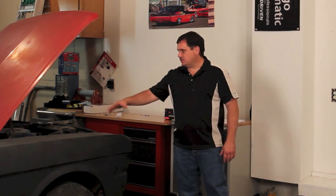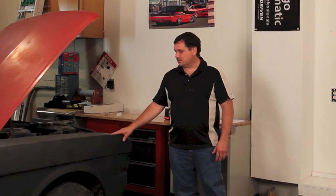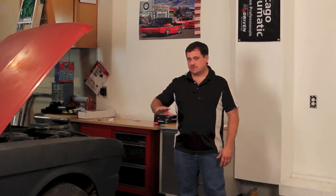Now if I've got just a small area of bare metal, self-etch may be just fine. There are some 2K self-etch primers that can cover an entire bare metal panel. So it's just kind of a preference. In this video I'm using epoxy, but I could have used self-etch as well. Some advantages of epoxy over self-etch: epoxy is very user-friendly and very compatible with other products. You don't have to worry about anything lifting like you might with self-etch primer. You can lay epoxy over just about anything — body work, sanded paint, metal — and you're going to be fine.